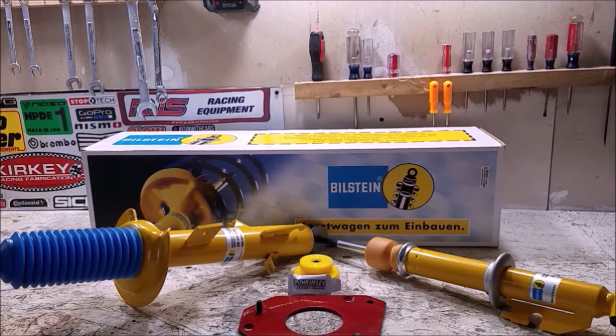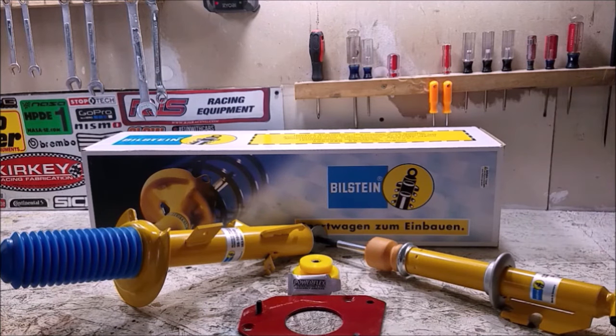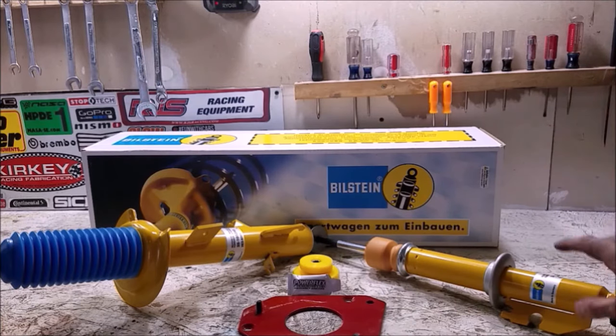All of their dampers are named with the letter B followed by a number. The B4 dampers come in black and are the OEM equipment you'd receive on a German car, or an OEM equivalent for American or Japanese cars. Step up to the B6 — which is what I've got — and it works with stock ride height or a slight drop, giving a heavier-duty, sportier damper. The B8 has the exact same damping setup as the B6 but is designed to run with a lower spring, accommodating a one to two inch drop.